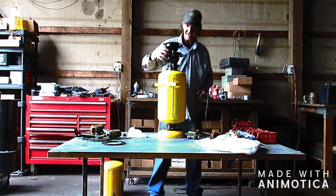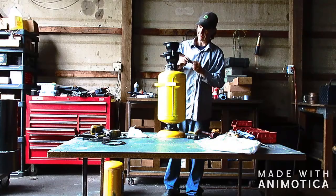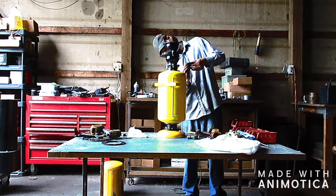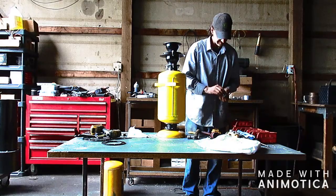And this is how you're going to light the unit too, is through those jet rings. So you want to be very careful that you don't move that around too much with the washer alignments. They get out of whack. It can be a little difficult to get the bolts through there. And if they get too far out of whack, then you gotta take it all back apart.